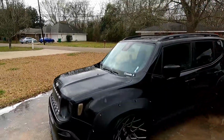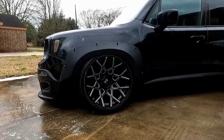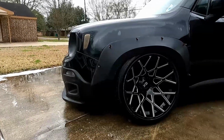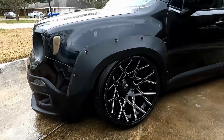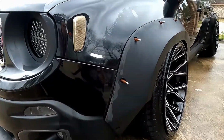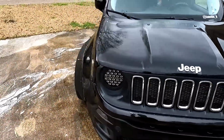And up next we got the Renegade. So quick walk around if you're not familiar with it. We got the bagged, I guess, wide body. It's got fender flares, sitting on KMC XD 831s. They're called Chopsticks. They're 20 by 12, minus 44 offset with a 3/4 inch spacer. So they're sitting out pretty wide, all on these fender flares that I made. I mean, they've seen better days. So along with the whole suspension rebuild and engine swap, I'm gonna end up making new flares. Might as well, getting that far into it.